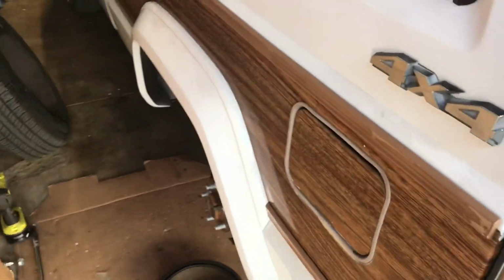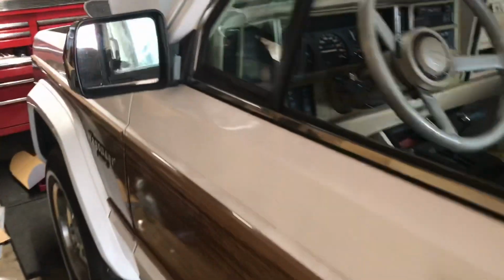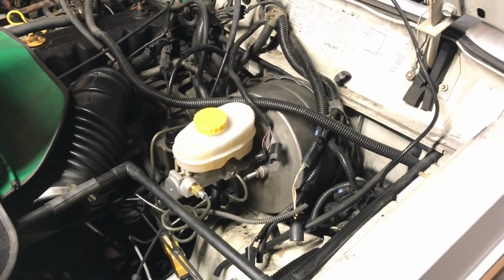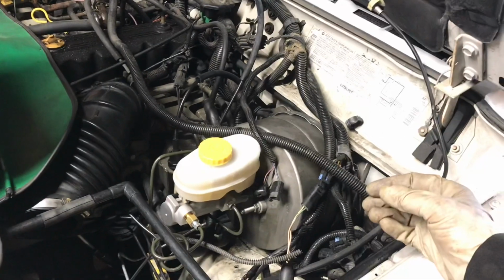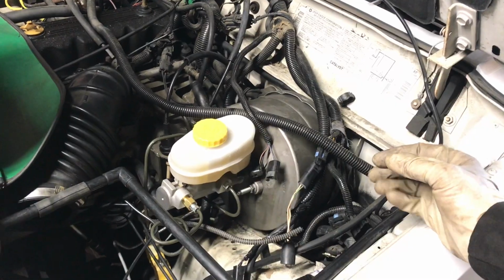Oh yeah, my pedal still sucks. You got to change the wheel cylinders. It makes sense, maybe more fluid, get more stopping power. I think a lot of the conversions I'm reading are guys who strictly off-road with their Jeeps. They just want to be able to stop big tires. It wasn't a lot of people getting rid of the Bendix system. It was mostly guys going from single diaphragm to double for bigger tires. So we'll try this today and go from there.